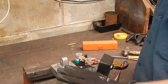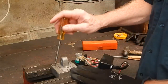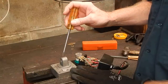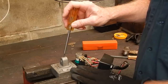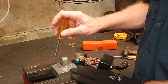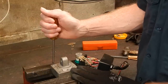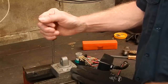So I start pulling it apart, and of course it's put together with Phillips head screws with a T-slot in them. Being aluminium, steel screws going into aluminium over time bond to the aluminium. I work on motorbikes quite a bit and it's a common problem, particularly with Japanese and Asian motorcycles, because they don't use Allen-headed bolts. With Allen-headed screws you don't have much trouble breaking them free because the Allen head won't skip. But with Phillips-headed and slotted ones, you try to undo them and it will just jump on the head, tear it to pieces, and before you know it you've got nothing left to grip.